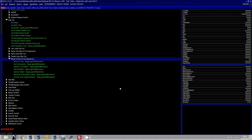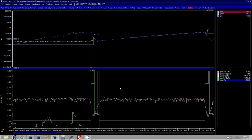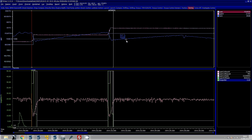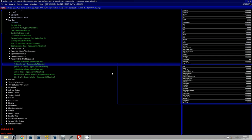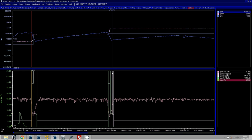The ramp in is the end of the cut sequence. It smooths out the RPM during the change. On some sequential gearboxes you'll see the RPM trace jump up and down - a bit of ringing on the engine from prop shaft shock due to the harsh gearbox change. The ramp in applies a soft torque reduction - in this case 80 milliseconds of 12 degrees of ignition retard after the shift is complete - to take some torque out of the engine and smooth that RPM, which works very nicely.